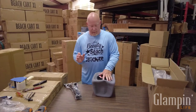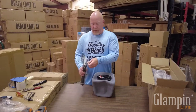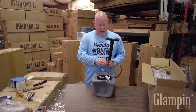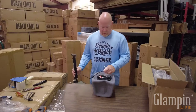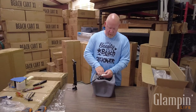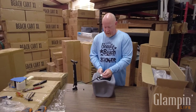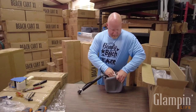Hand pulling you don't really notice a lump, but put it behind a golf cart or bicycle and you'll see the cart starting to bounce. I'm going to be 100% honest with you - this is not the highest quality hand pump you'll ever have, but it works. When you take it out, make sure the two ends are tightened. When you go to pump up your tire, push down on the valve all the way, otherwise you're going to hear what sounds like an air leak because you're not getting a good connection. You may need to put some pressure behind the valve to make sure you get a good seal.